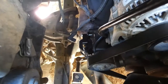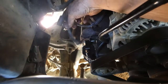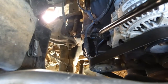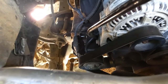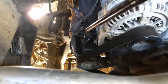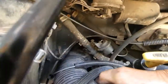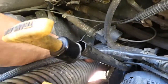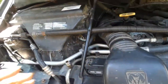There it is in place. Now I'm getting ready to put this back on. Ignition coil replaced — definitely $80 saved. I'm going to put back the breather thing here; that's the only other thing I took off. And then start the car. Push that on there until it clicks, kind of — until it's on there good. And then push it down here. That's it.